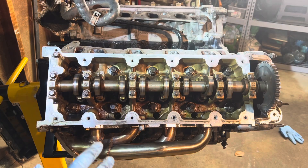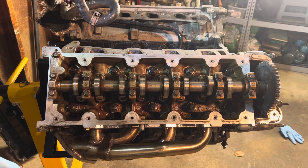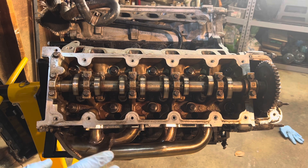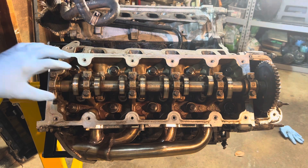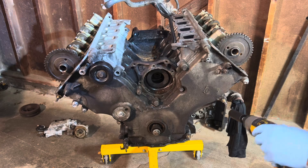Next, let's see what's under these valve covers. After looking at this head a little bit, it seems like there's some fouling — they either used conventional oil or synthetic blend oil and did not change their oil as much as they probably should have. But regardless, they look okay. Time to take the timing cover off.